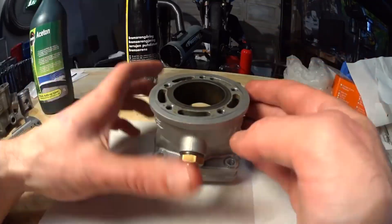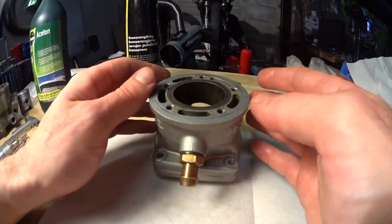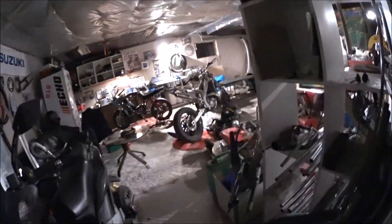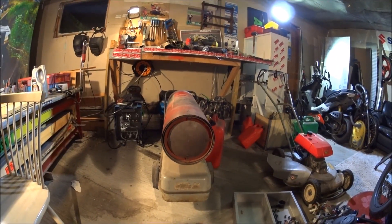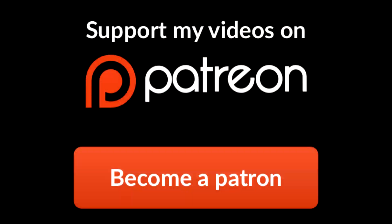Welcome back to my garage — well, actually it's my girlfriend's office. In my porting tips video I stated that raising the exhaust port might not be such a good idea. The high exhaust port will give you a much smaller RPM range where your pipe is in resonance. And Brett Presniel wrote: why is gaining exhaust area by raising versus widening the port possibly a bad idea?